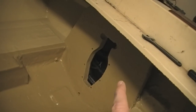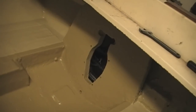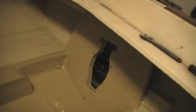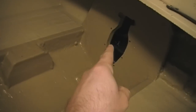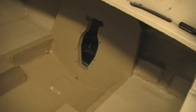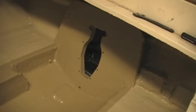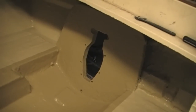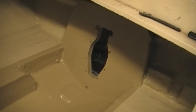I had to cut the hole out first, so I test fit the transom into the boat and traced out the inner hole, then cut it out with my jigsaw — I think I burned the jigsaw up doing it. You'll see two little ear-shaped cutouts on the top of the transom hole. Those are for the steering arm that moves the outdrive side to side; if you don't cut those out, it doesn't get its full range of movement. The way I did that — I have the original Mercruiser installation manual — it said to use a one-and-three-quarter inch hole saw at a 60-degree angle in those areas, and it came out perfect, looking identical to the original. Then with the holes cut out and the PL glue applied, I stabbed it in there, clamped it down, and left it for four solid days to make sure it had a nice, solid bond.